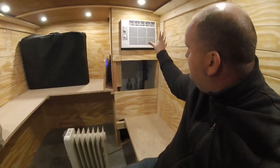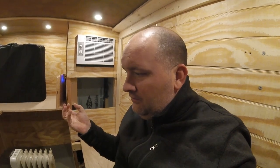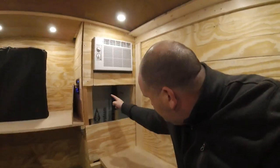I didn't get a lot of images of the AC in regard to how I did it. That's actually good because I don't want this to be a how-to, because I am fumbling my way through all this. I could be messing stuff up. I'll put links in the description to the stuff I bought off of Amazon, but essentially I got the tray from the bottom of a dog kennel. It's the perfect size for my AC. I used a little drain attachment that would typically go in an aquarium. I drilled a hole in the plywood that it's all sitting on. I got a little barb and a tube that runs down and out to the bottom of the trailer so it can drain if there's any condensation.